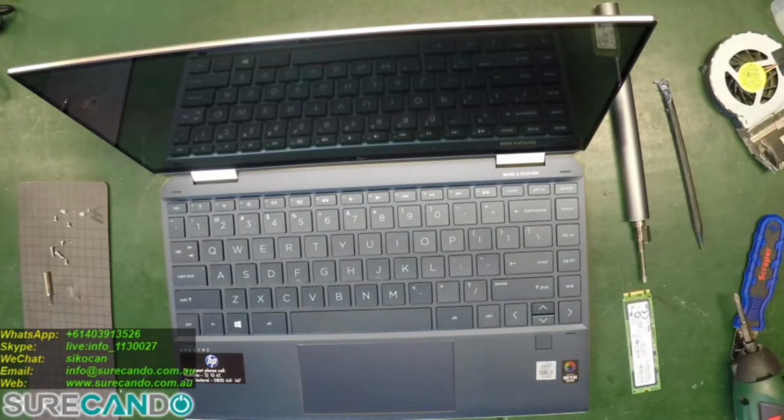So I've just pulled it out of the box and attempted to power it on. All I get is 5 long caps lock LED lights and 3 short LED lights on the caps lock, and according to HP's website that indicates a motherboard problem.